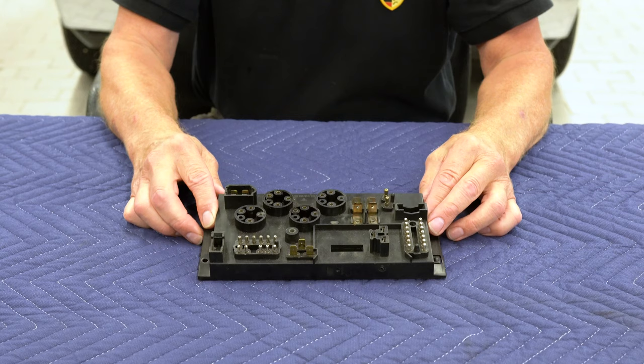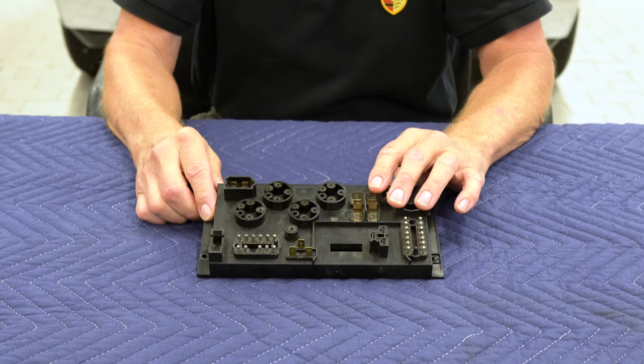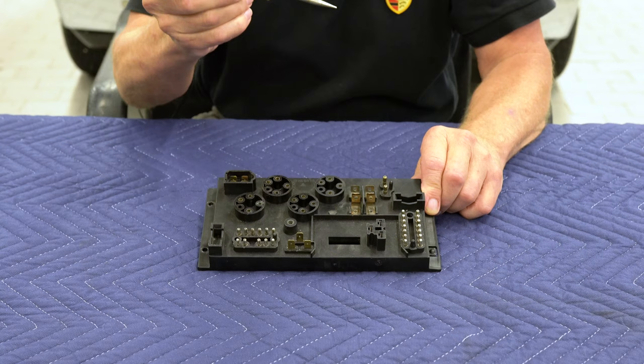These days, we don't have to do that anymore. By a brief tour of this relay board, you can avoid stranding yourself on the side of the road like I did, get a quick fix, and drive home. I'm going to discuss the 914 four-cylinder relay board — they only made maybe 3,600 six cylinders, and that relay board is totally different and not as significant. So we're going to start with a stripped four-cylinder relay board so I can show you the different pieces, where the accessories plug in, and I'm going to use my handy test light.